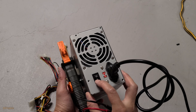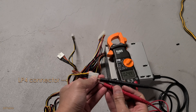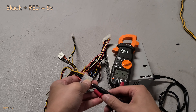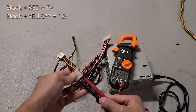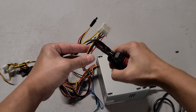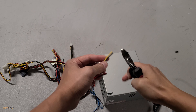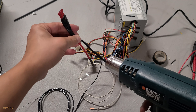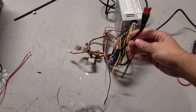Let's switch on the power supply — you can tell the fan is running, which means it's working. Run the voltmeter on the LP4 connector, which was originally used to connect to your hard drive or DVD-ROM. Any black wire is ground and red is 5V. Switch to the yellow wire and there you go — we got 12V. What we need is black and yellow; the other two wires, red and the other black, we don't need. Connect the inline fuse to the yellow wire and extend it with another wire.